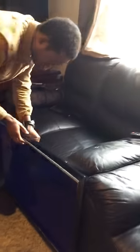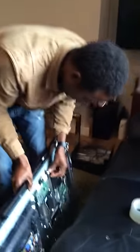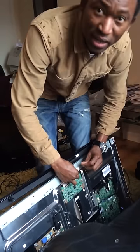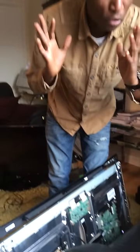To resolve the problem, we need to cut a small rectangle of tape about one-fifth of an inch, and cover this edge line of the flex. Once we cover it and put it back, that will create more pressure on the other lines and fix the connection. It may not work for you on the first try — just keep going, keep trying gently, until it comes good. Don't force it; sometimes it works first time, sometimes it takes many attempts.